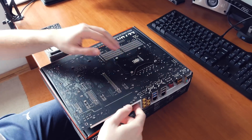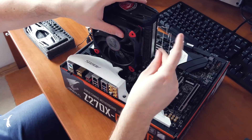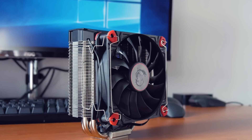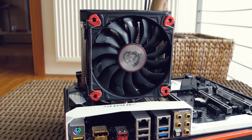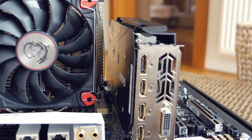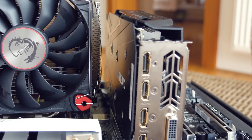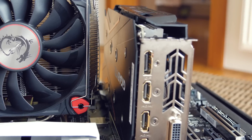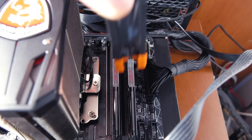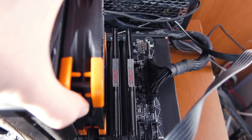When it comes to installation, although in my opinion it has a few more parts than it maybe needs to, the whole process was pretty painless and straightforward. I was done with it in less than 10 minutes, and that's without a user manual since I didn't get one with this sample, so I had to look it up and wing it. The cooler has a bit of a center offset so it doesn't interfere with surrounding components, although in my case with the fan facing the I/Os it didn't make it compatible with the first PCI Express slot as it just hovered over it — but that's more an uncommon scenario. I'm sure that if you turn the cooler around 180 degrees, you'll have just enough room to clear that first PCI Express slot, which is probably the reason they offset it in the first place. RAM clearance is alright especially when the cooler is facing the other side, while in the other more usual scenario it could be a tight fit, although it seems doable. If you want to be 100% sure, buy low-profile RAM sticks somewhere up to 50 to 55 millimeters in height.